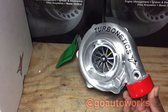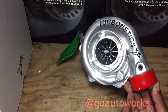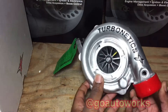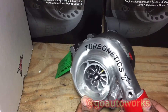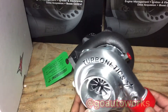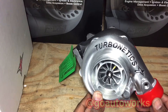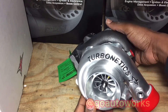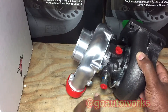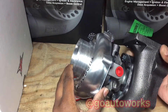Okay, this is the new T3 C15 48-57. It's a 48mm compressor, 57mm turbine wheel. It's in their compact package, so it's pretty much like a straight T3. This is the same size as the old T3 Super 60s as far as fitment, so it works out really well. This particular one is journal bearing, but I got them all with oil and water cool cartridges so you can add water lines to help extend the life.